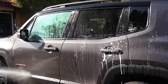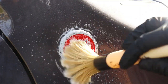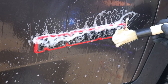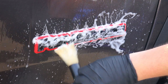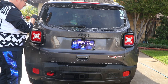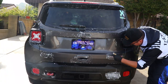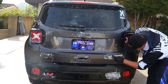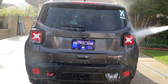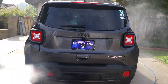There are other methods of doing this, such as snow foaming the whole vehicle and brushing afterwards, doing the contact wash and brushing at the same time, or how I'm doing it here — working in small areas with a spray, brush, and rinse technique. Whichever method is fine as long as you address the areas as needed, but in my opinion, doing it like this helps cut down water usage and ensures the spent product doesn't dry up when in direct sunlight.